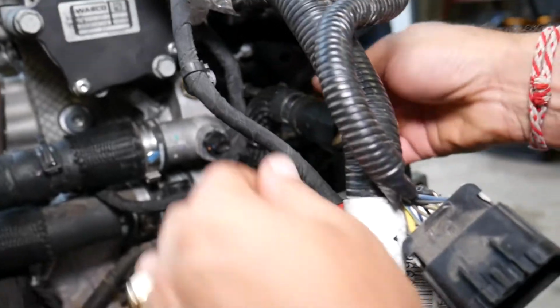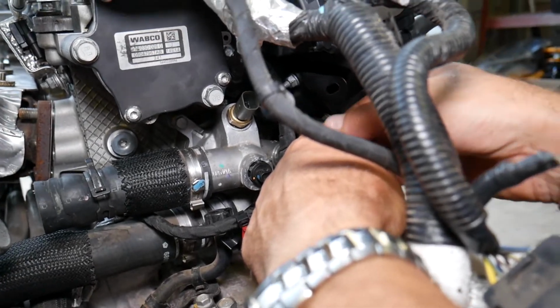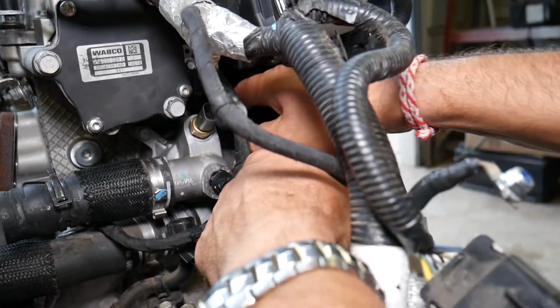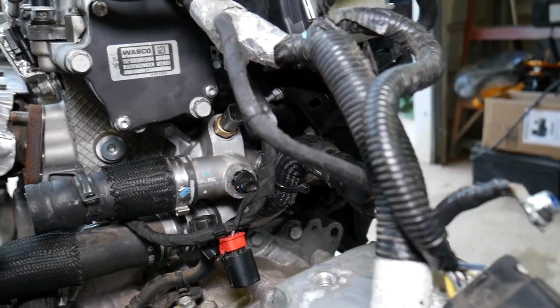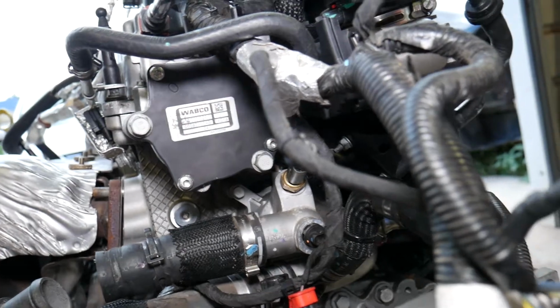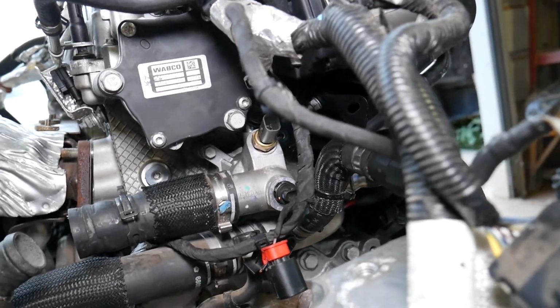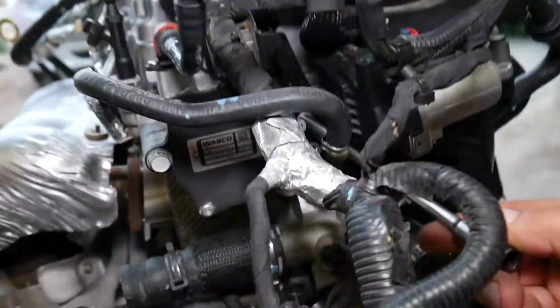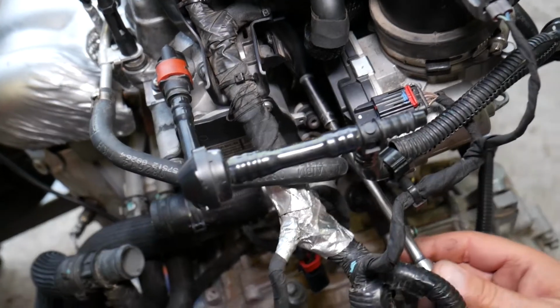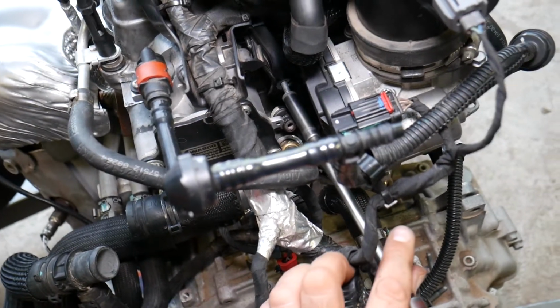And that metal plate, okay, we'll need to get it loose too. The one that holds the intake right below the throttle body. Otherwise, we won't be able to pull it out. There is one more bolt on top of it with an 8mm socket. Otherwise, you will mess up the new gasket when you try to install it, and you have to do everything from the beginning. So, okay, you can see where this one is now. Perfect.